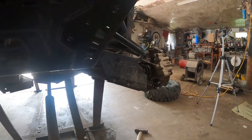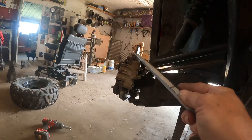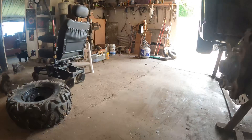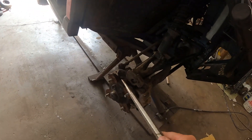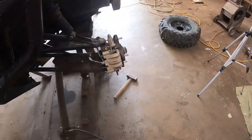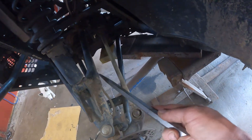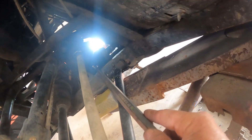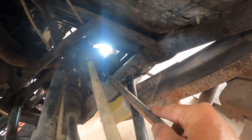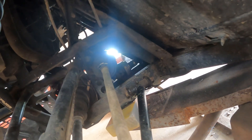This is looking like a big job. You have to take the brake caliper out, then take this nut off, and then the hub comes off so you can get the shaft out. You also have to deal with a pin that goes in there — people say that's a pain to get out, but with an air chisel it apparently comes right out.